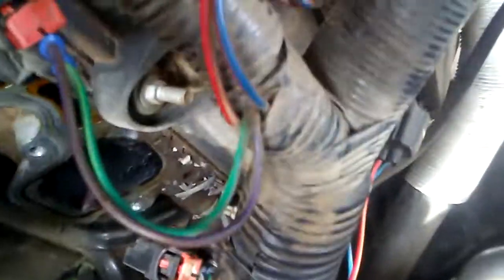I got the intake manifold off. I think it's going to take a special tool, even with this clip off here, to get that fuel line off, the fuel line tool. But there's the hose clamp, and with the sticks in the way, and with the manifold out of the way, it's still hard to get to these.